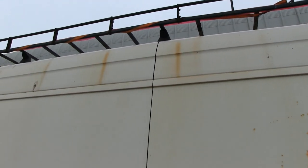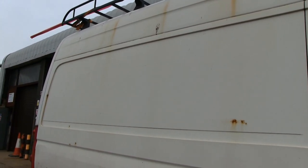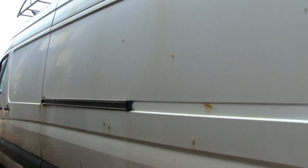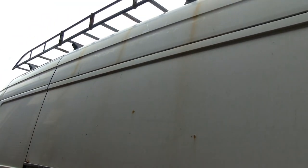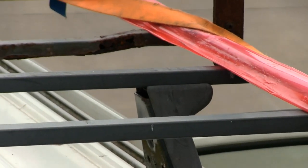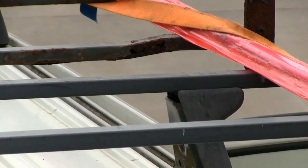You can see the extent of the damage — there was lots of rust, lots of scrapes and cuts. The factory paintwork on these Mercedes Crafter vans is the best testament that whoever painted it at the factory must have been on the schnapps. I also have a roof rack that rotted away, and on the sides of the van the rust runs down with rainwater. You can see lots of different rust spiders growing underneath the paint — all from little stone chips that pierced through and allowed moisture to contact the metal below.